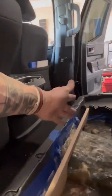This front panel is complete. So this is our height right here. That's just about an inch and a half less than right here. And over there, it's exactly an inch and a half for the clearance of the speaker's travel. So now we're going to put those panels in place and glue them in temporarily, and then pop that whole piece out as one panel. Hopefully it all comes out with no problems. And then we'll do the corners and everything like that.